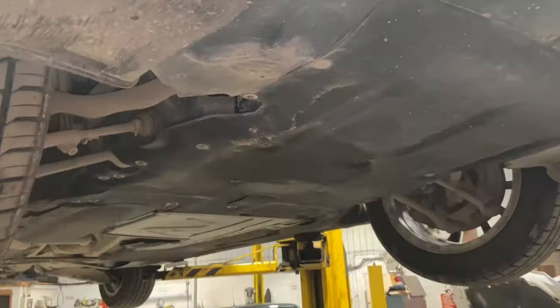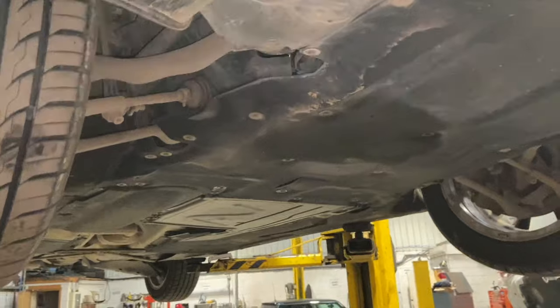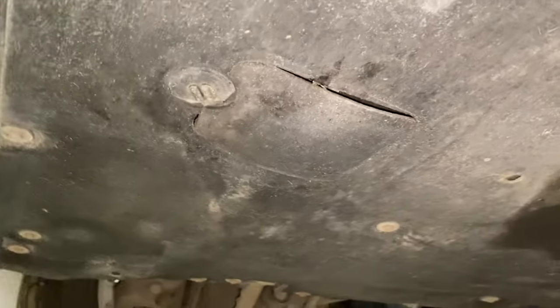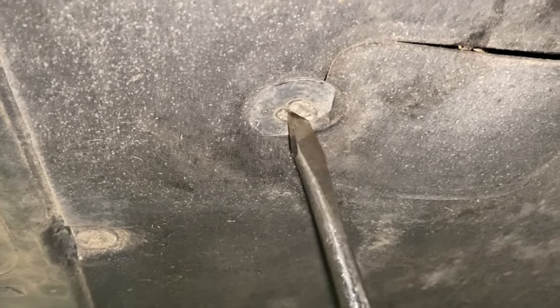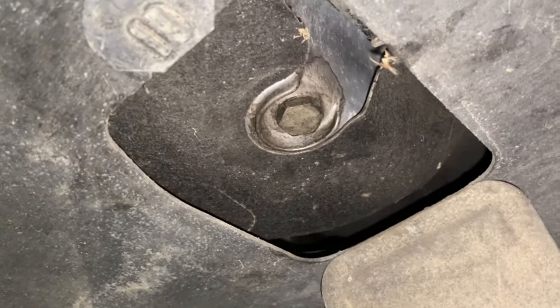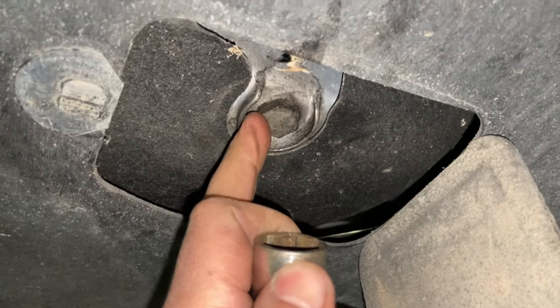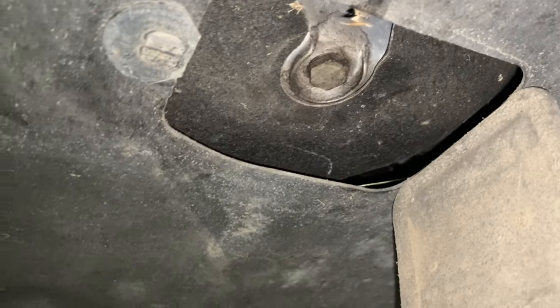Now that we've got it up in the air, you can see these BMWs have got a full under tray covering nearly half the front of the car, but they do have a little inspection piece just for the sump plug — which is a bonus. All you need is a flat-bladed screwdriver, turn that to the flat, then pop the cover down to access the sump plug. You're going to want a 17mm socket to get the sump plug out. There is a seal on there that we'll be replacing, and I'll run you through the torque setting when we refit it.